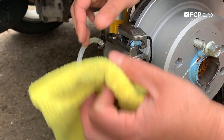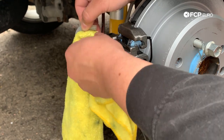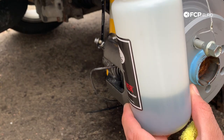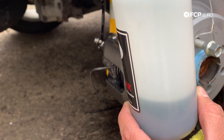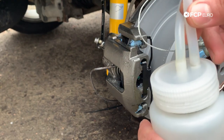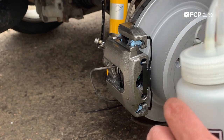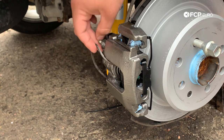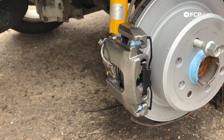I'm going to grab a little towel so when I pull the catch can off I don't make a huge mess all over the caliper. I'll remove the hose gently and clear out the line — and that's what we took out. You don't have to take out this much, but I was able to see that the line to the catch can cleared out, so that's as far as we're going to go. I always like to join the silicone end of the hose back to the catch can so there's no error in case you knock it over. From there I'll take the wrench off, feed the brake sensor wire back through, cap off the bleeder, and that's it.